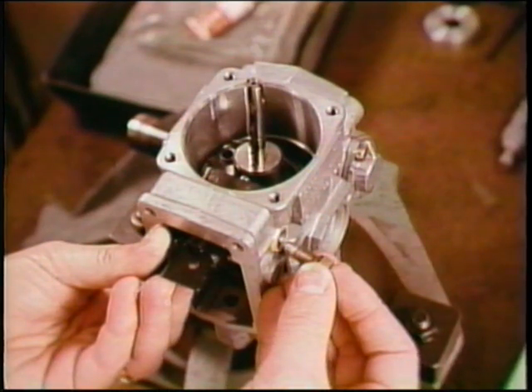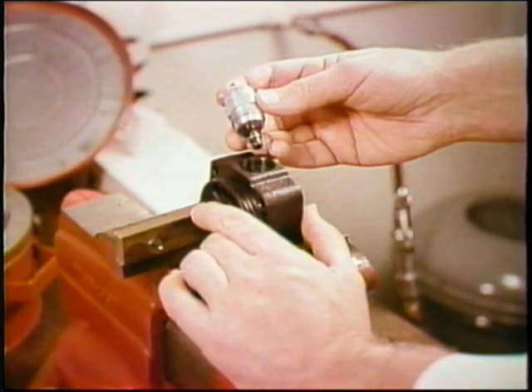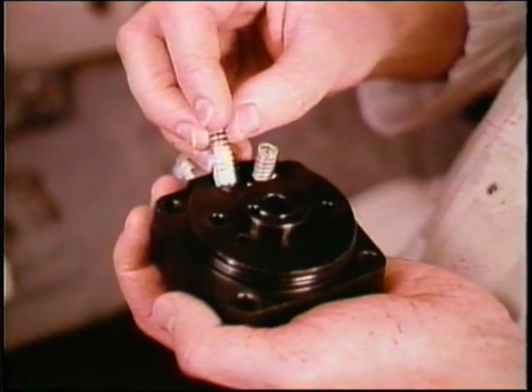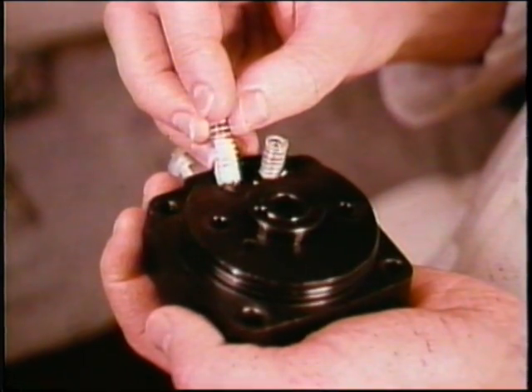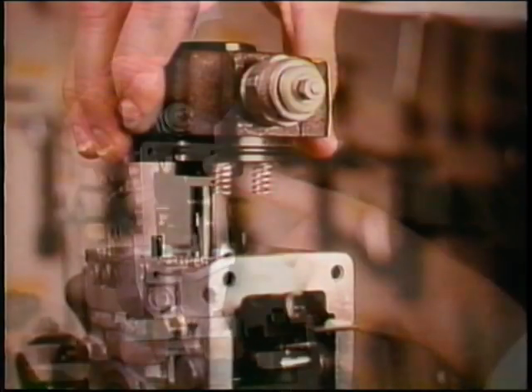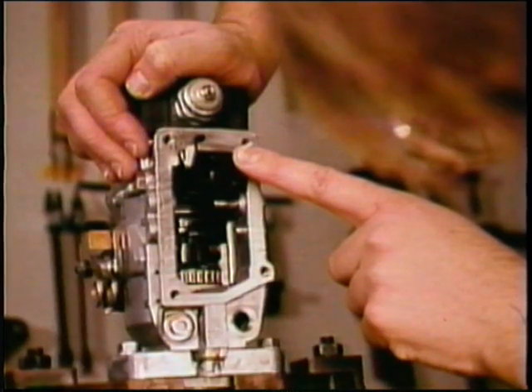Distributor head. With the distributor head clamped in brass jaws, install the stop solenoid. Line up the lower spring seat so that the guide pins match the head. Recheck that the ball is in the sleeve socket. Grease these compression springs before you put them in place — that way they won't fall out when you turn the head over. Now, without cocking, lower the head onto the plunger and slide it into the housing. As you wiggle the governor lever, watch that the metering sleeve does move — that way you're sure the ball has engaged the sleeve socket.